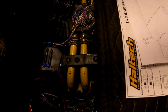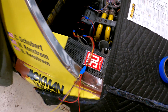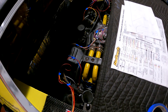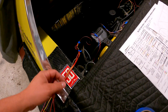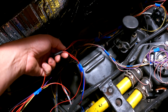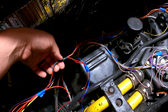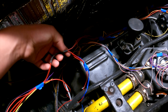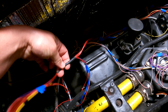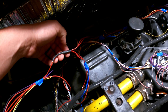The only thing I've added since we last looked at it is AVI-3 back in — this yellow wire — which I'm going to run inside the car to the wideband controller I already have, so I can input that straight into the computer. Quick side note on injector power: I have one 18-gauge wire coming into four 20-gauge wires. I've seen people say 22 or 16, but I went with 18-gauge connected with an un-insulated connector, then double-layer heat shrink going to four 20-gauges, two here and two there for the injectors. This heat shrink is really nice, and I did find these un-insulated roller connectors — I need a slightly better crimp tool, but it's a good way to split out injector power.